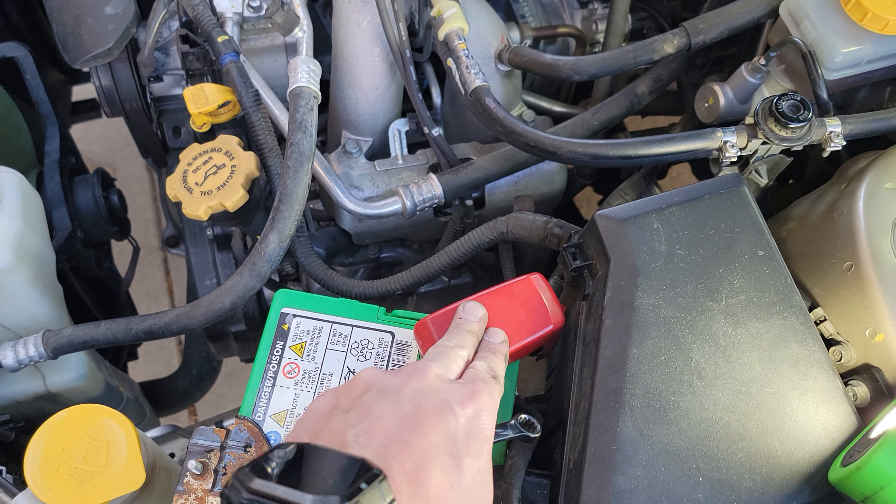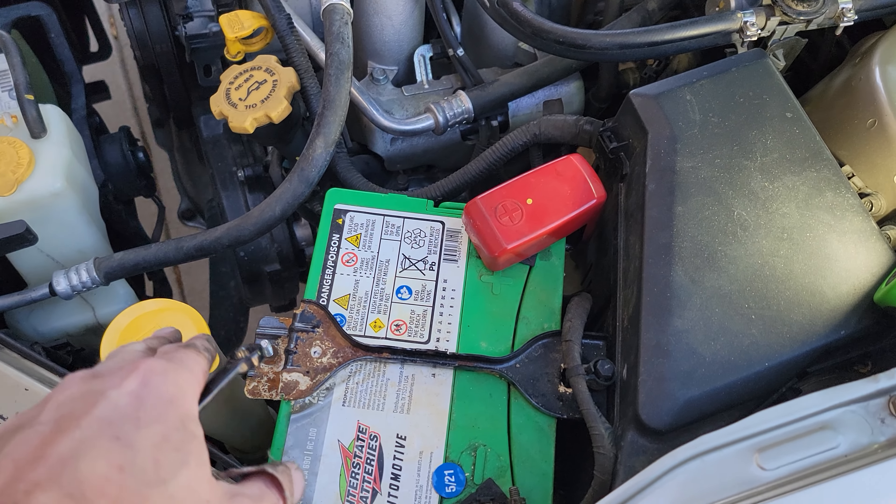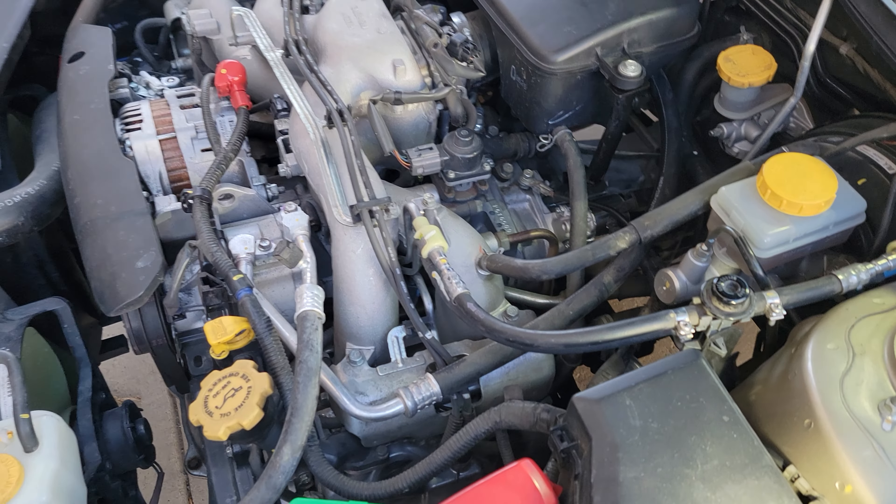After you're done, reconnect the power, make sure everything is picked up, and don't forget any lights or things you have hooked in the engine compartment — I've left those in there on accident before. It's also a good time to check the oil and fluids and top everything off. And that is how you install a starter on an older Subaru. I appreciate you guys being here. If you stumbled upon my videos, I ask that you subscribe, hit the notification bell, and a thumbs up. Feel free to comment and ask questions — I try to respond on my channel.